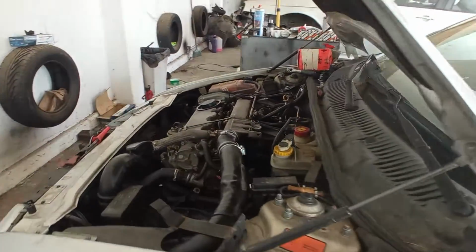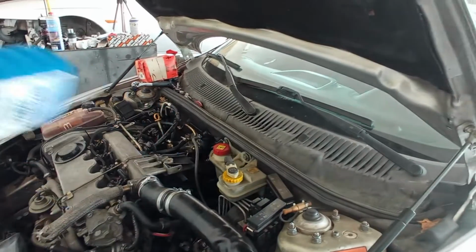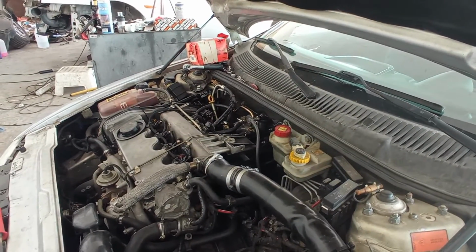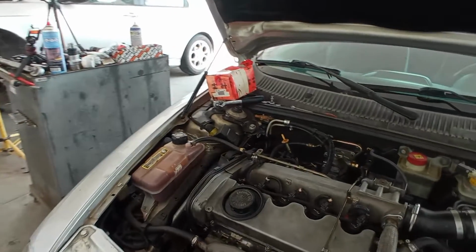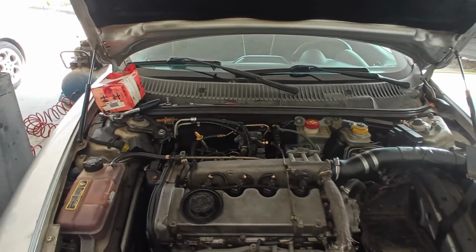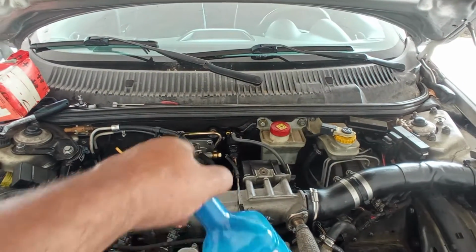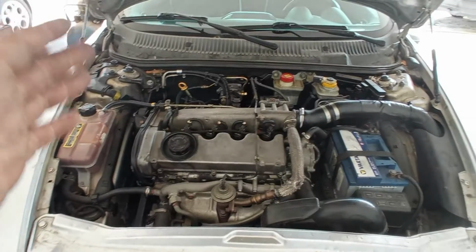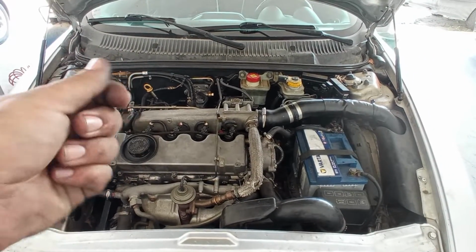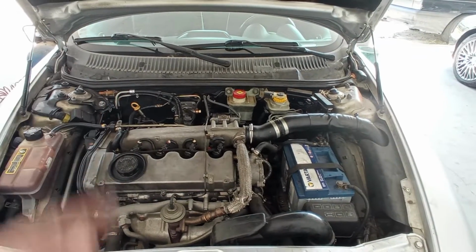We are very close, and I will connect the power box at once, because then I want to do a very thorough cleanup on the engine bay, and I do not want any open circuits, and not to mess anything up. To see also, because I had some fuel leaks over there, I replaced a bunch of stuff, and I want to see if I have more leaks. Now you know the drill. You just want to cycle the ignition a bunch of times, and the low pressure fuel pump will take all of the air back to the tank.